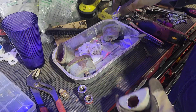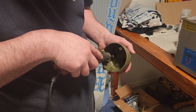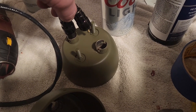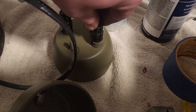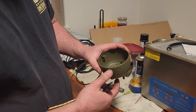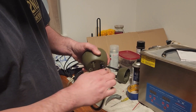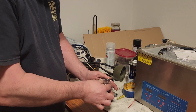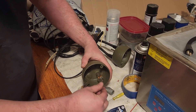That gives a nice clean finish. Getting ready to fit those bulbs in the housing, the first thing I needed to do was grind the paint out of the socket so we'll have a good ground connection — that really becomes a theme on these taillights. Now that bulb is going to twist right in there. The sockets provide spring tension for the bulbs to stay in there, and those just twist in the back. The stop light is going to be on this side. Now the harness can just push in and lock, and then we'll need more bulbs. You can push a bulb into that spring, give it a twist, and it locks right into that housing.